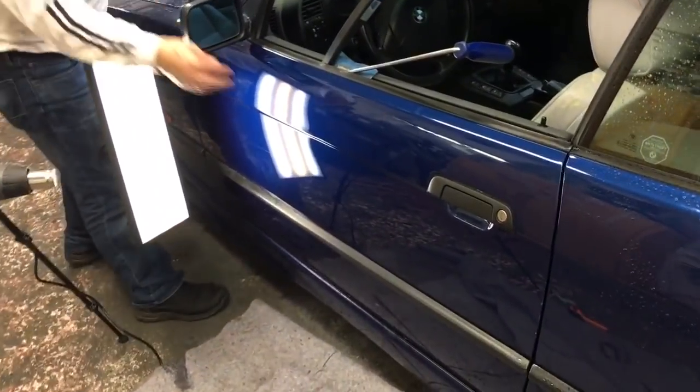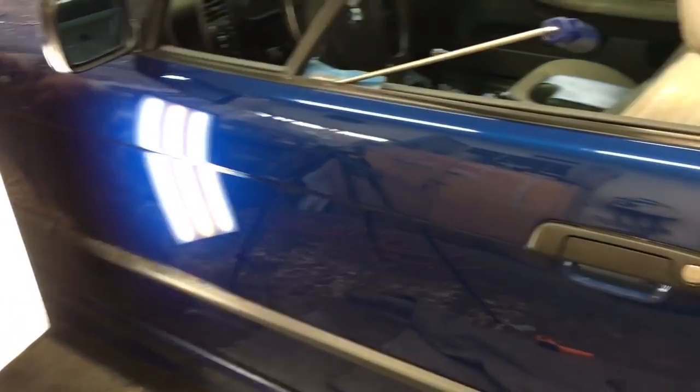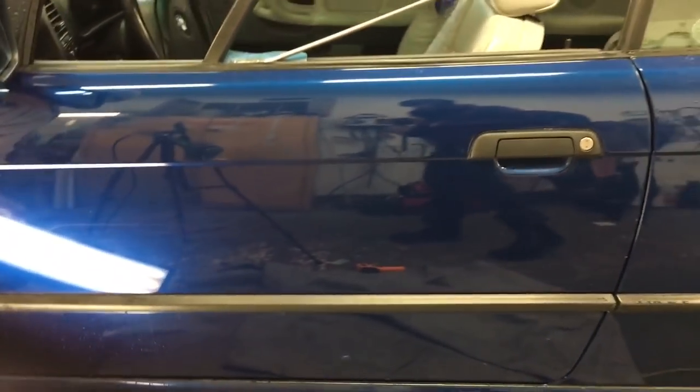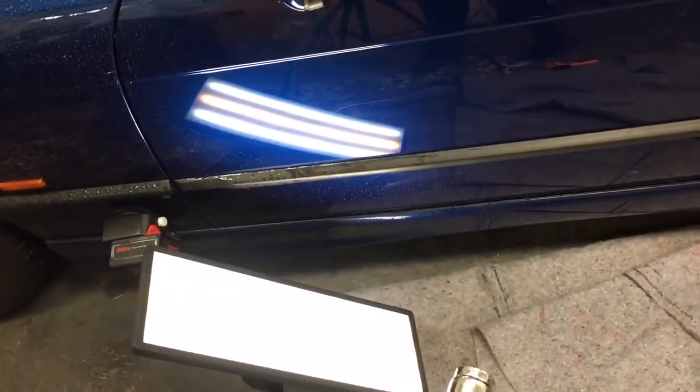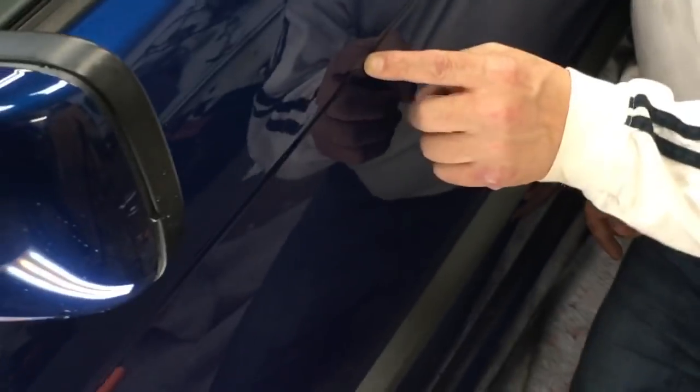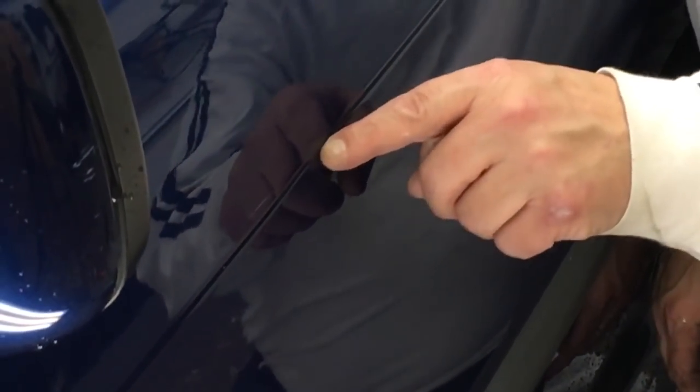This part — I know it still has a little dent to it and a little brow to it, but at this point I have to cross check. I have to go down like this, bring the board up at an angle. Now I can see I've got a little bit of a low here. This bit of low on the top edge has got to be brought up, and this one on the bottom edge just has to be reefed out through the middle. Let me show you what I mean — let's get it nice and warm.